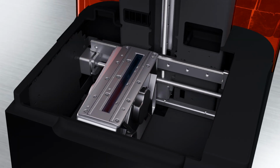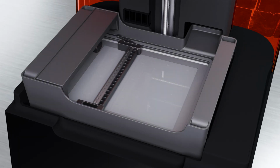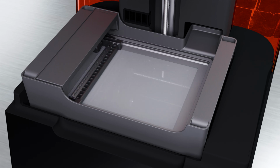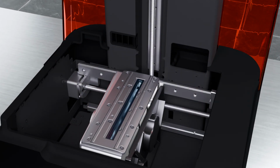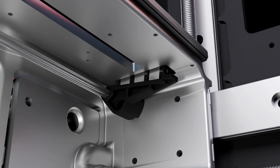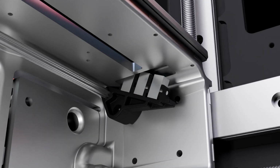At the start of each print, the LPU housing pulls the tank mixer back and forth across the tank film several times. The magnets inside the LPU housing will move into alignment with the mixer magnets when it is time to move the mixer and move out of the way while the printer is lasing.